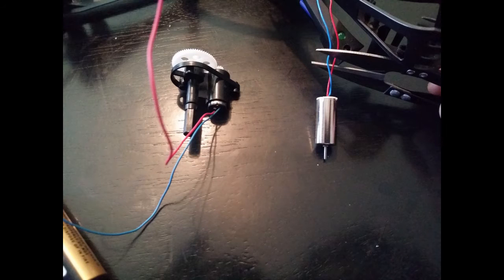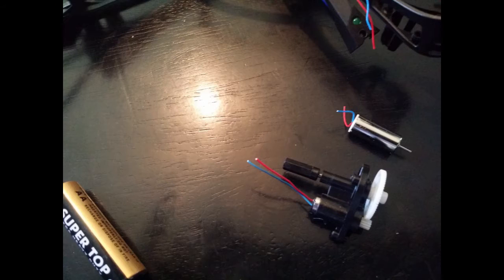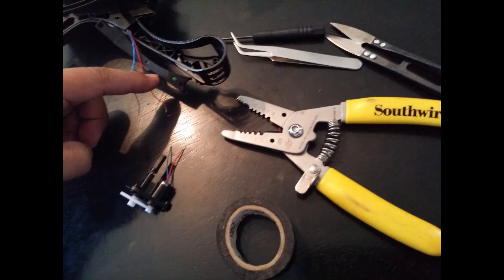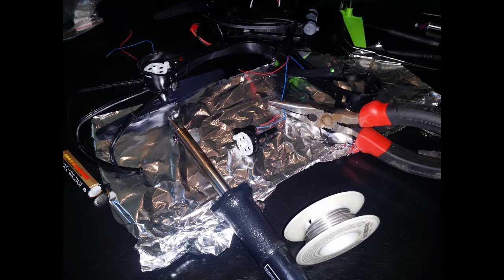Get ready to cut the old wire out with scissors and get rid of the old one. You can test it again with the battery if you need to. Leave plenty of wire so you can get it back in there, then prepare to solder. Strip down the four ends — the hot and the neutral on each side. I put a piece of foil down so I didn't mess up my table.